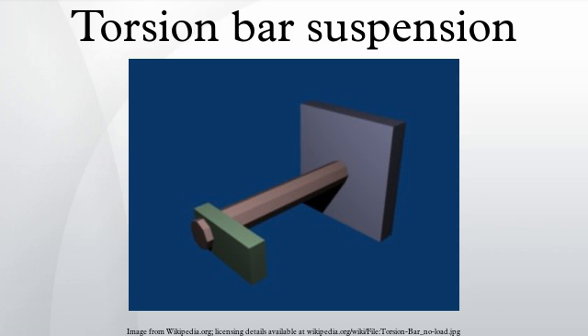Twist-beam rear suspensions were pioneered on the Volkswagen Golf in the early 1970s and remain common on compact cars and minivans. The German World War II Panther tank had double torsion bars. Needing bars longer than the width of the tank to get the required spring rate and maximum elastic bend angle from available steel alloys, designer Professor Ernst Lehr created a suspension that effectively folded the bars in half. For each wheel, one rod was attached to the suspension arm, while another was mounted to a nearby point on the frame. On the opposite side of the tank, the two rods were attached to each other and fitted into a pivot. Deflection of the suspension arm caused both halves of the double torsion bar to twist.